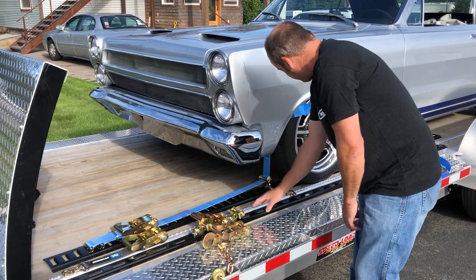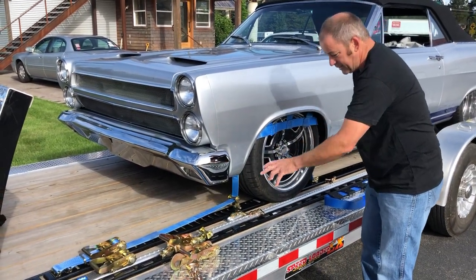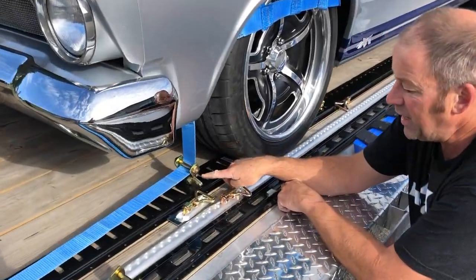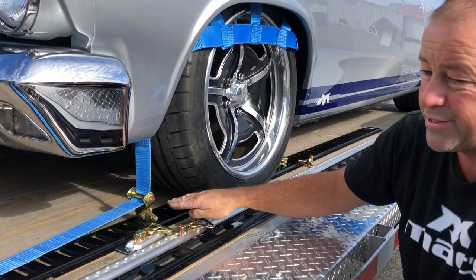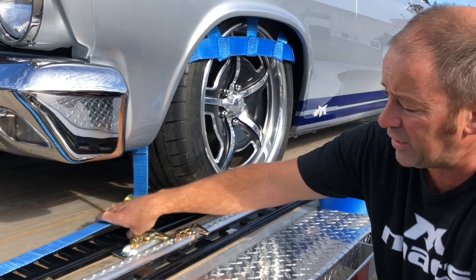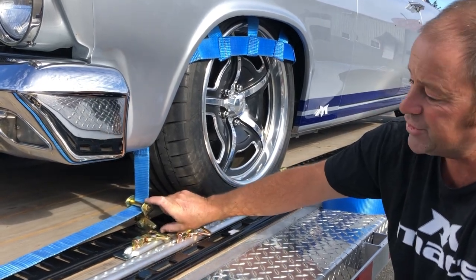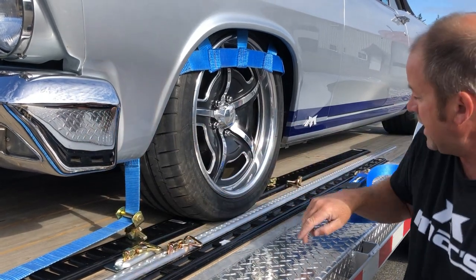Now, if I take that same piece and lock it into the vertical E-Track, notice how it lays down nicely. Same goes with the idler fittings and E-Track fittings bolted or attached elsewhere in the track. This is our E-Track idler — it's a very helpful piece to transition the webbing horizontally so that you're not attempting to operate a ratchet handle up under the front of the car. It's about two and a half inches tall, allowing that webbing to transition nicely and clear just about anything.